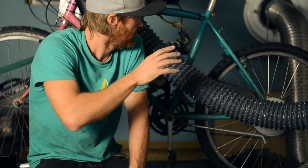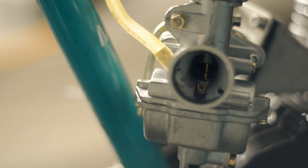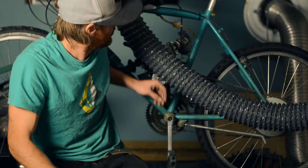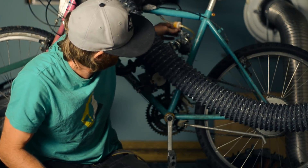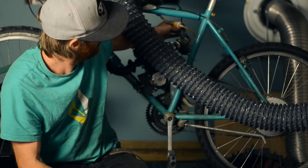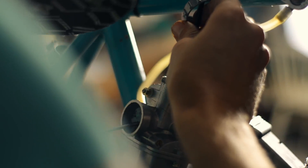We are ready. I had a slight problem with the throttle cable — it is too short from factory. I had to hack stuff together a bit. I removed the adjustment screw on top and chopped off a little piece of the sleeve, then threaded the rest of the sleeve in there, but it seems to be working.